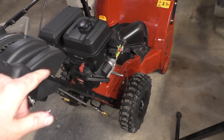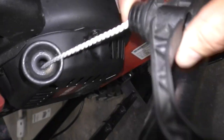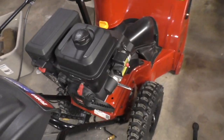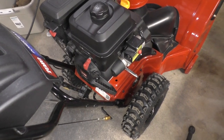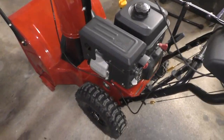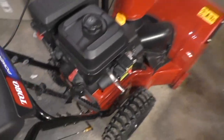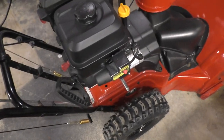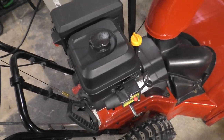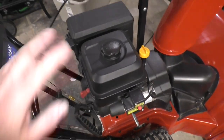The only thing to ever go wrong with this one was that stupid rope. I think it was chafing on something — maybe it was that grommet right there. There are no sharp edges on it, so maybe there was a burr in the metal that just didn't get found and it destroyed my rope prematurely. I'll keep an eye on that because it could be a big problem. Fortunately it has an electric start backup — you just plug an extension cord in right here and press this button. I've only used that feature once just to see if it worked. Oil changes I don't skimp on because it's cheap insurance. Belts I'm not worried about because there's no miles on this thing — I think I used it three times last year.